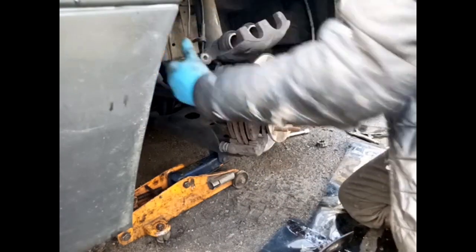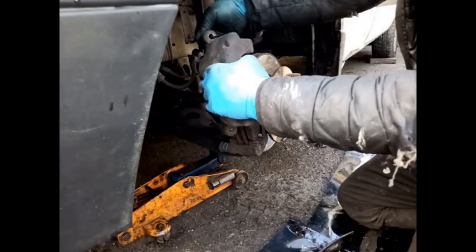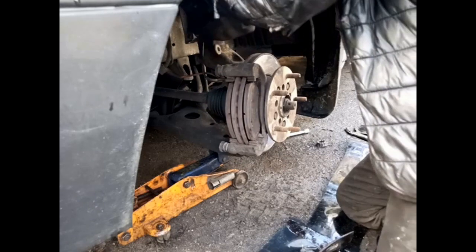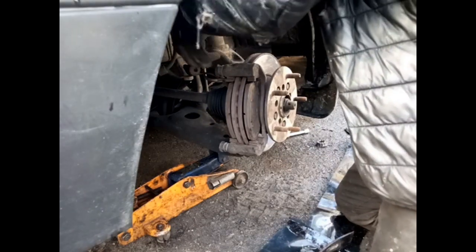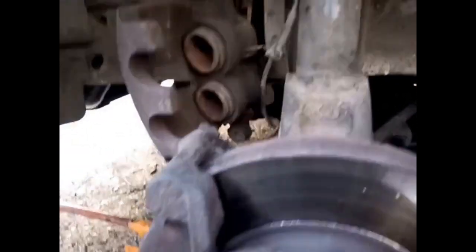I'm ready with my piece of cable off the top of the suspension leg spring, which I'll put somewhere, perhaps with that hole there. See? Get high so it's out of my way, but not straining that rubber hose, because that's what this is all about. It's so that that hose, see it, is not being pulled from the weight of this caliper.